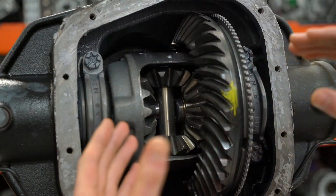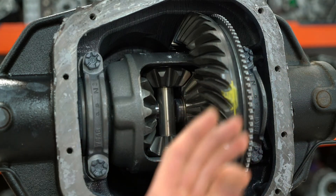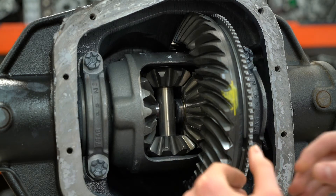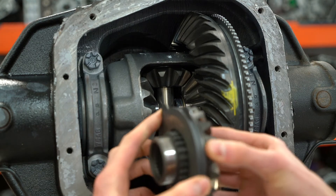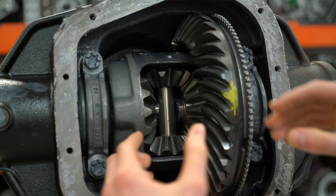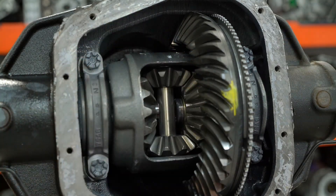So when you're making a turn, the limited slip differential can act like an open diff in that the thrust force from beveled gear separation is not that high, which means it's going to allow these clutch discs to slip on both sides of the differential case, allowing both wheels to turn independently — so it can make that turn without chewing your tires up.